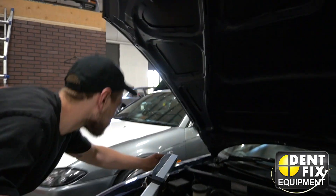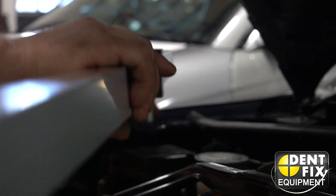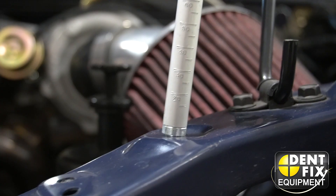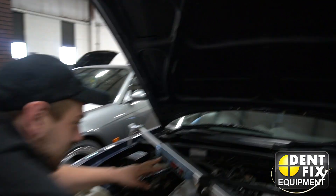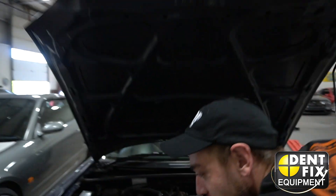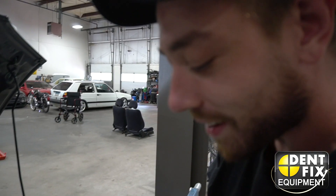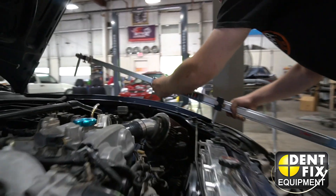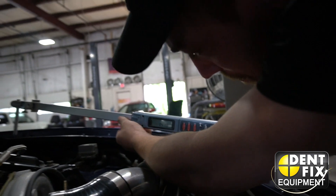Let's find a straight car and find some symmetrical measurements. We'll go to the center of the fender bolt, which is probably not normally a hole I like to use, but this car is very straight. When you see something like that — this car is exactly 1,300 millimeters — that's usually a good sign. Manufacturers don't normally like to build cars without a round number. We come over to the other side, and it's exactly 1,300. If the cross measurement is perfect, normally you're not running into any issues. We'll take a length measurement, and we're at about 1,414 there, maybe 1,413 there — so we have a 1 millimeter difference across the whole thing. This car is straight as straight can be and definitely falls within tolerance.